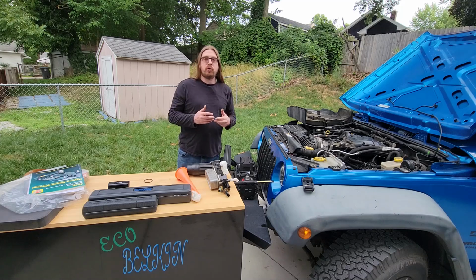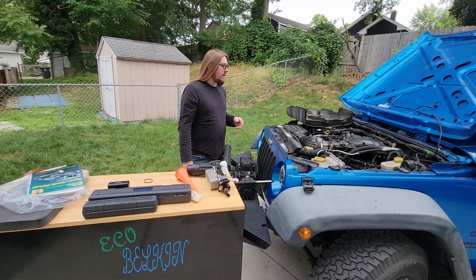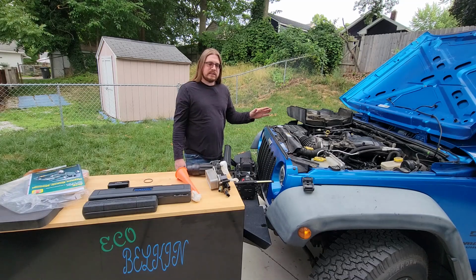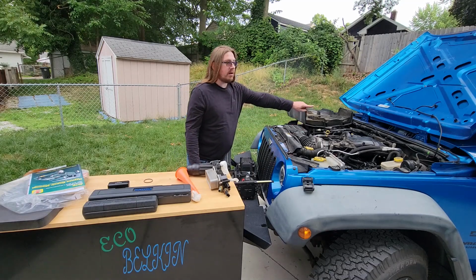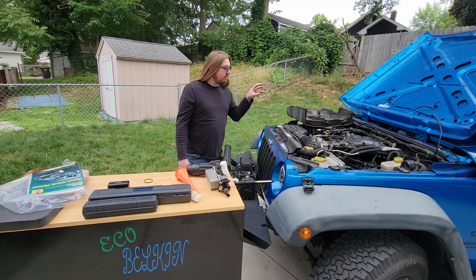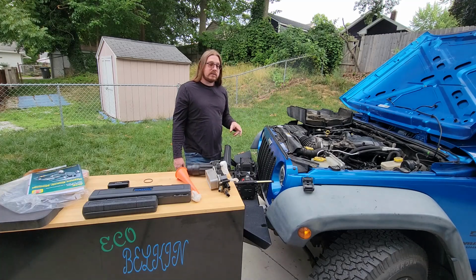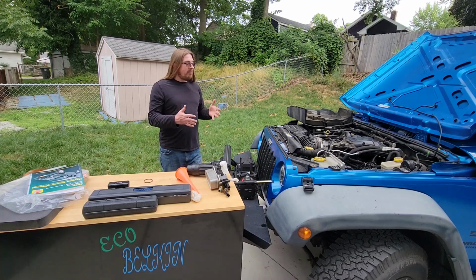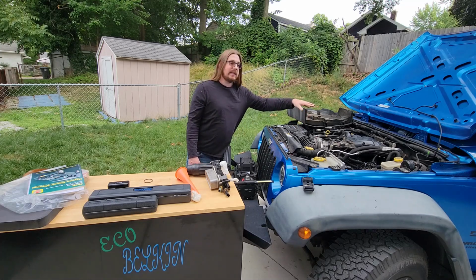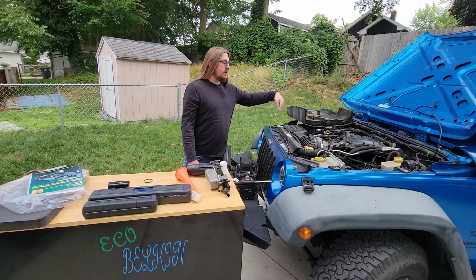That's also with filming YouTube and going and getting other supplies like paper towels and whatnot that I might have needed. There was some time spent with the, you probably want to bring a flathead screwdriver, because I spent some time pulling all the fuel injector wiring harnesses off as well. And on a vehicle this old and this kind of crusty, you want to be very gingerly when you're in there so you don't break any of those connectors. I also spent probably about 15 minutes with the fluid extractor, extracting all the fluid out of the valley of the engine and cleaning that up as much as I can. And another 10 minutes cleaning up, as you saw, the intake ports as well, clean up around those.